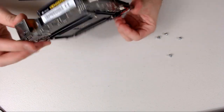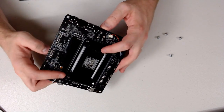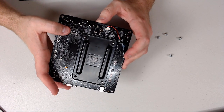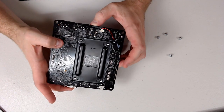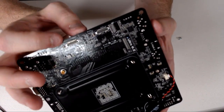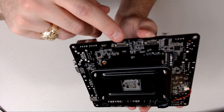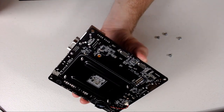So that's our motherboard tray — we'll use that for the build. On the back we've got our standard AM4 backplate, which is super nice. There's a second M.2 slot on the back — I want to say it's SATA or x2 PCIe, not a full-length full-fledged NVMe, so I'd stick to lower-bandwidth options there. The little SATA headers connect up here. There are a couple SATA cables that came with the box that latch in. Since SATA drives don't take a lot of power, the wattage should support that connector.